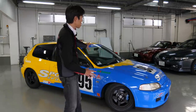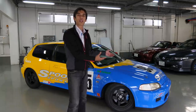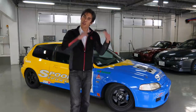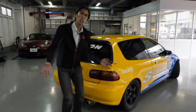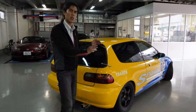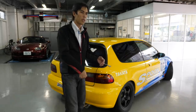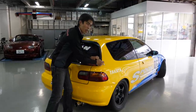The body is all original — no parts have been changed for aerodynamics. In the old racing series, N1 was basically a completely stock car, while Super Taikyu allowed some changes like the bumper and rear spoiler. This car doesn't have the iconic Spoon ducktail wing or lower lip. Visually, one key difference between a road car and a race car is the bonnet pins at the front, because in racing there's no time for a driver to open a standard latch when coming into the pit.